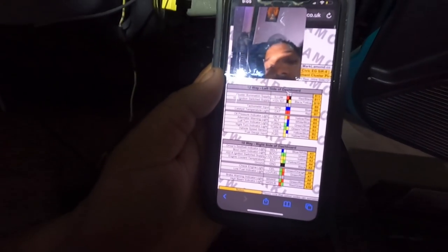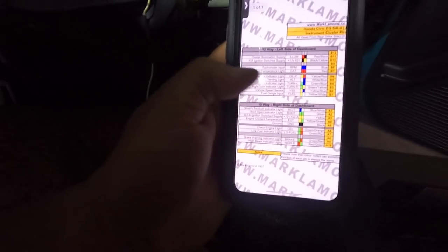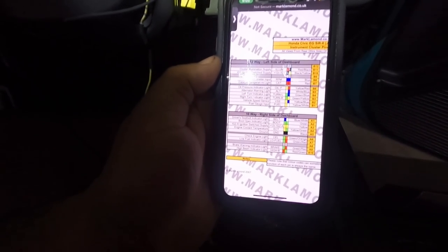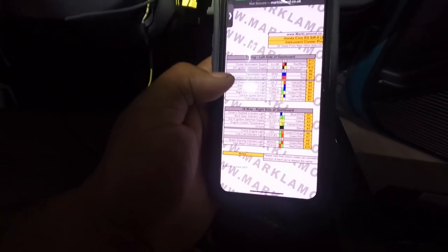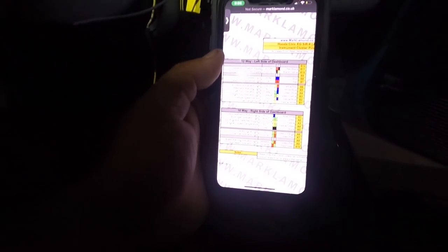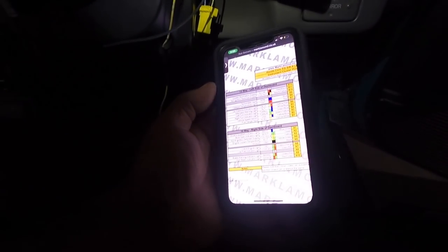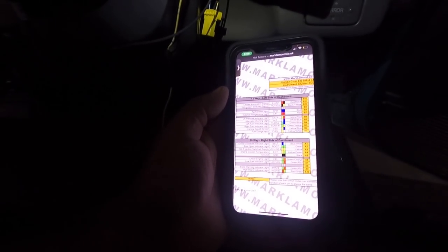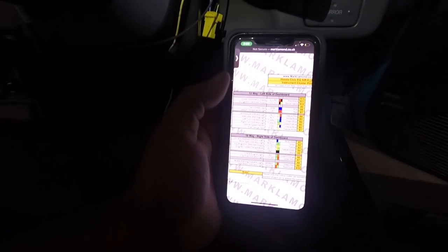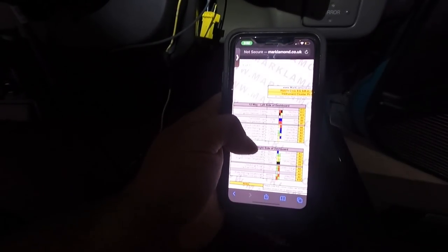So as you see, this is my pin out right here. Left turn, right turn. Everything else here, like the check engine light, the cooling temperature, all of that stuff, the ECU reads, so there's no need for me to run that to it when the ECU is going to tell me exactly what all of these do.